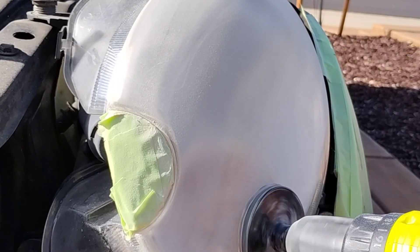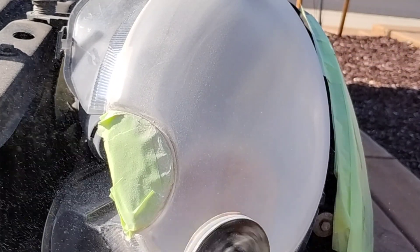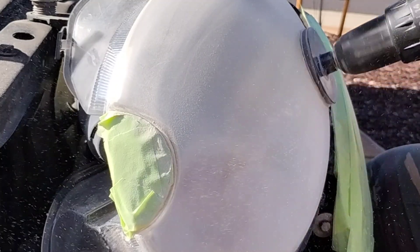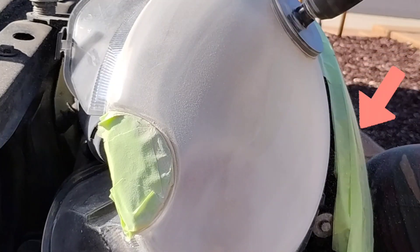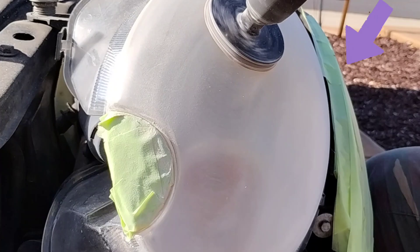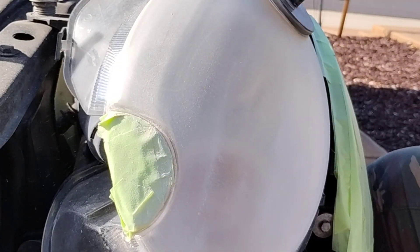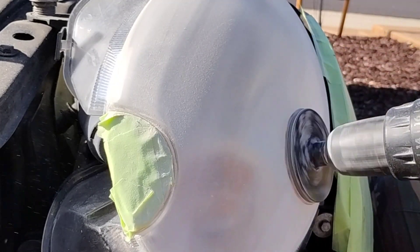It takes forever with little tiny half-inch, inch pieces to make the turn, because you can't tape a circle with a straight piece of tape. But as you see, all I did is tape off around here and tape off this piece here. This tape right here is just a precaution — you probably don't have to do that. But being that I'm spraying, you just want to be safe. I put a little bit of tape there — not a huge tape-off job like I normally do.